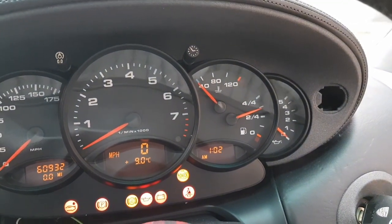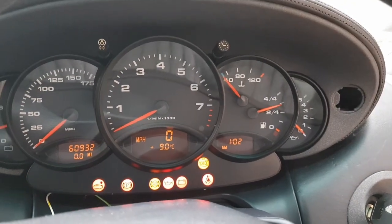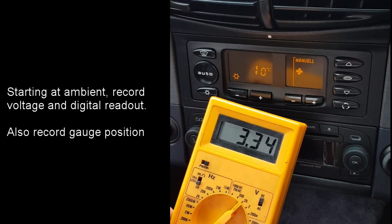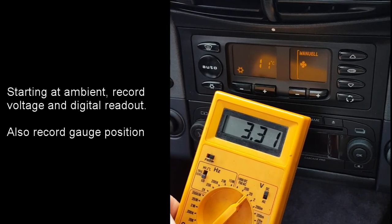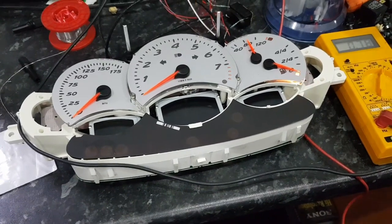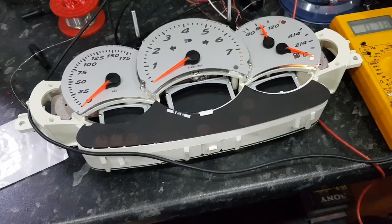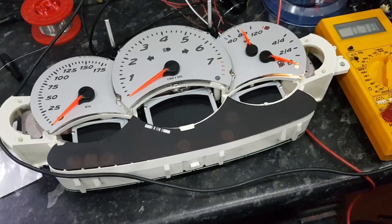So now what I'm going to do is start the engine up, and then as it warms up I'm going to take readings of the temperatures shown on the digital display, on the voltmeter, and also on the temperature gauge. Started the engine, so now we can see the voltage is reducing as the temperature rises in the coolant. I have a spare instrument cluster here which I've opened up to determine what the pull-up resistor is and what the sensor drive voltage is. By using these values along with the voltages and temperatures I determined from the car, I've been able to characterize the sensor.